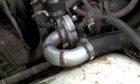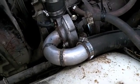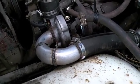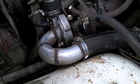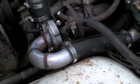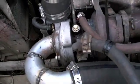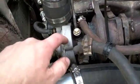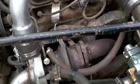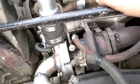Tremendous amount of low-end torque — really quite impressive, especially now that I've tweaked the carburetor and timing a little bit. Much more than I would have thought. It's not a speed demon; I doubt the 0-to-45 times are all that much shortened. It's really sort of a grunty, low-range, bottom-end kind of torque, which is not at all what I expected. I guess it's what comes from having a properly sized turbocharger. This is a T25/T25, so it's a little one — you could go smaller, but this came off a two-liter motor, and the 134 cubic inch motor is more or less a two-liter motor, so it seems to be reasonably well matched.